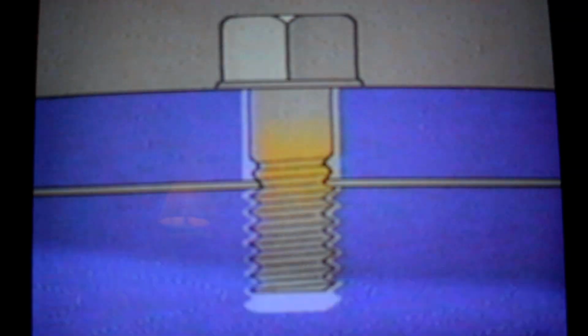These bolts were identified by a reduced shank design. A full shank design, similar in appearance to the conventional bolt, has been used in all Buick 6-cylinder engines since the 1986 model year. Torque-to-yield bolts are designed to yield or stretch significantly when tensioned to a specific load. The bolts produce superior and consistent clamp load when the yield point is reached. Because of their special design, care must be taken when tightening torque-to-yield bolts. If the yield point is exceeded, the head gasket may fail and the engine may be damaged.